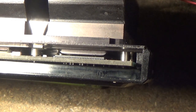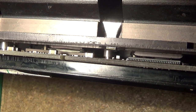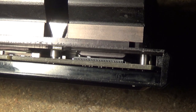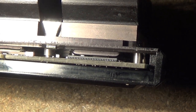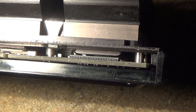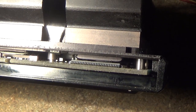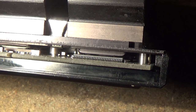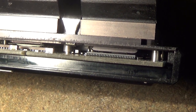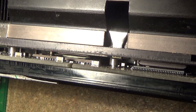The cache bin there is kind of interesting in its own right, because it's still technically external cache, I guess, because it's not part of the CPU, really. It's just part of the card the CPU is on. I mean, if it's part of the motherboard, as it is on later Socket 7 ones, that's what the CPU plugs into there. You don't class that as internal, do you? It's also half speed, so the Celeron, when that got cached, would technically have more in common with the Pentium Pro than these, even though it's the same architecture.